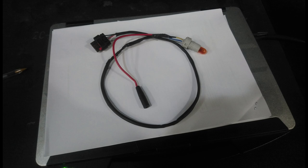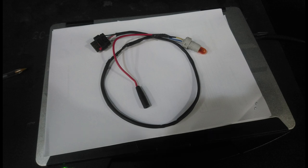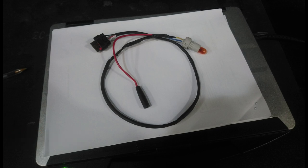This is a little lead I've made up out of the connector of an old sensor, and I've just soldered in a sidelight bulb — a 501 bulb — similar resistance to what the heater is. I'll just plug it in and clear the fault codes. We will induce another fault code for an open circuit on the oxygen sensor, but the oxygen sensor heater circuit will still operate. If you were to plug this directly into the original sensor with the heater circuit still in place, you'd have far too much resistance and the ECU won't operate the heater circuit — that's why I plug this in separately.